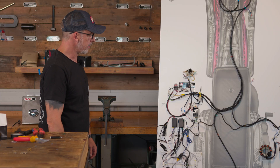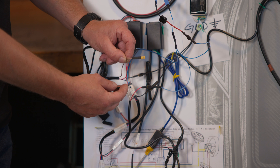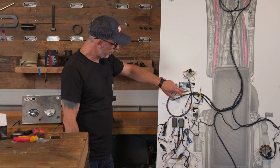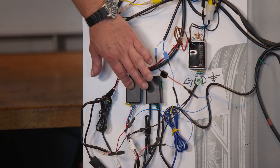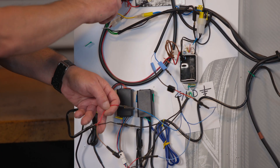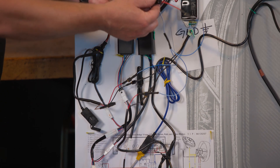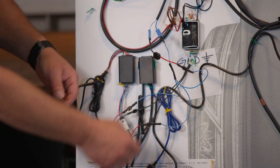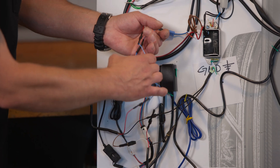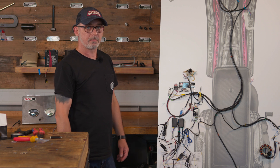We've plugged this together now, and thus we would have all the cables connected. We have attached a cable lock to the signal cable from the converter and the counterpart to the input of the speed signal from the black box — now we can put them together. With that we now have everything connected down, and before we reconnect the battery we check again to make sure we did everything correctly. We started with the speedometer and wired the black box plus wire to the distributor, connected to the fused plus from the ignition lock. We also fused the positive line at the indicator relay, and the ground wire from the converter and the black box is connected to the ground connector of the frame. On the vehicle you should lay this neatly with cable ties so that you don't lose track of it. Now you can reconnect the battery and the whole system works.